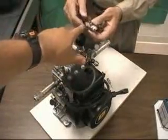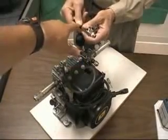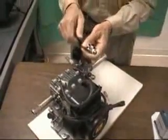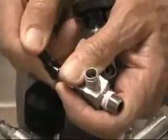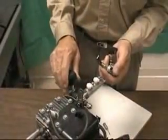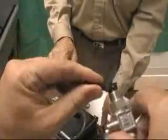Then there's a full feed valve which is variable — you can control it all the way from idle or off, where the needle valve is carrying the fuel, to a much larger flow, maybe ten times as much, for acceleration and high-speed running. If you open this all the way up it goes to wide-open throttle, and you could put this on the foot feed — controlling it with your foot through a cable.